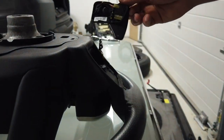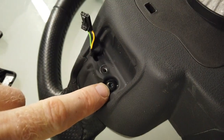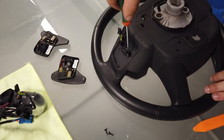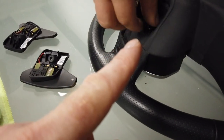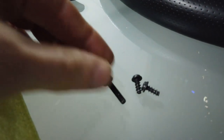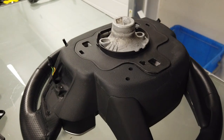With the paddle shifts off, that exposes another screw in here. These are coarse-threaded screws but the switch pack screws actually have a much finer thread and are much longer, so when you put it back together make sure you know which screw is which — these nice fine-threaded ones hold the switch packs on.